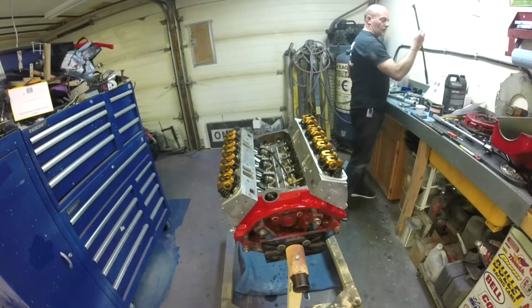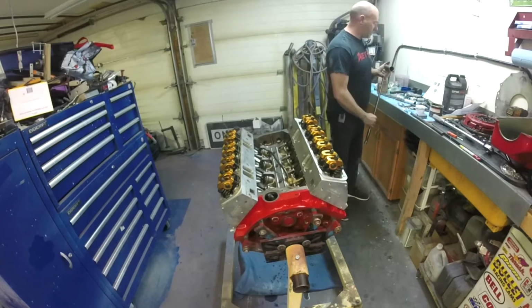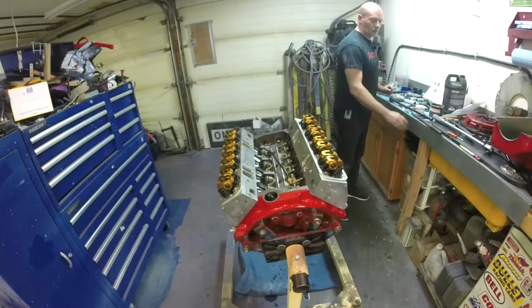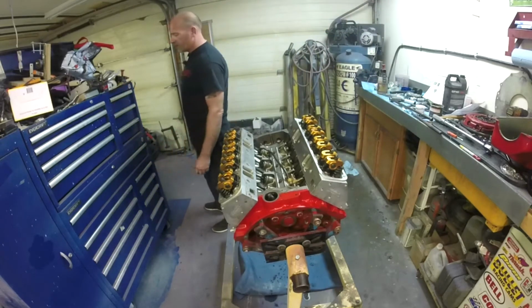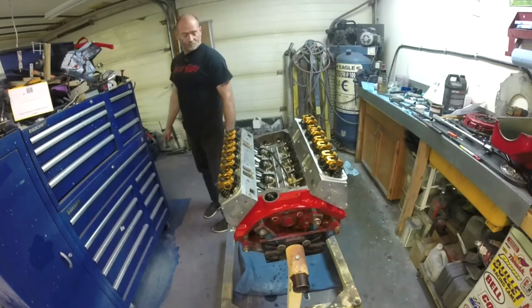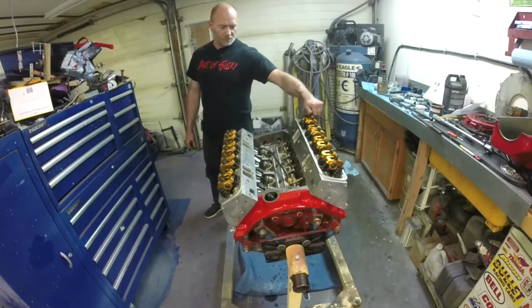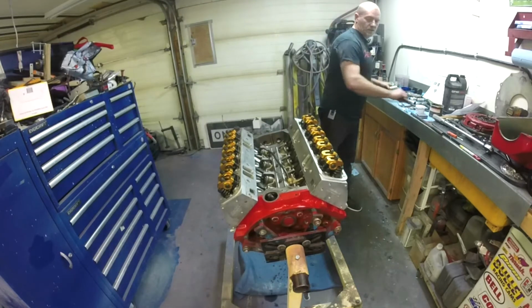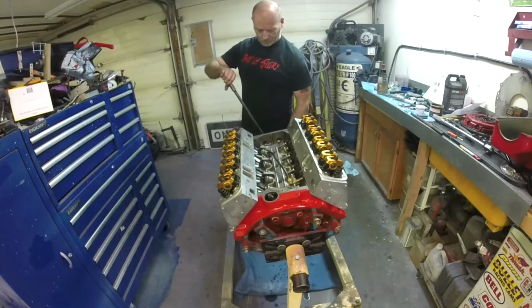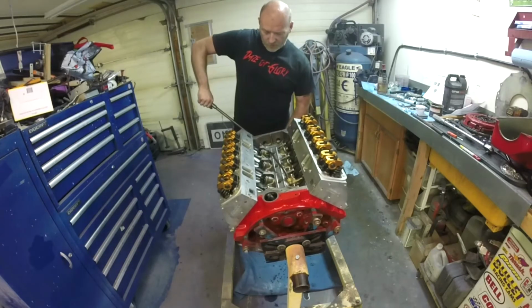It takes them off to tighten it up because when the engine gets to operating temperature, all your clearances grow. That's why your oil pressure drops down a few pounds and other things happen. So that's the ticket. That's what we'll do. I'm just gonna do them one cylinder at a time. I know there's ways you can go around it and do it once. Not worried about it.